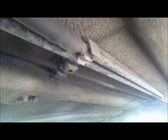The fuel line, you can see that fuel line is quite corroded, and also the brake pipes. Nowadays they try and fail you on these. I can't see that there's anything particularly wrong with that, but you have to watch out with that. Unscrupulous people put grease on them to cover up the rust.